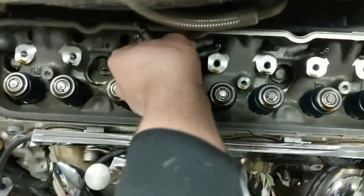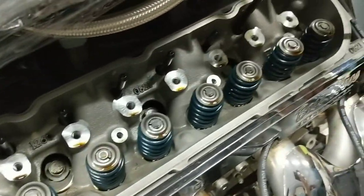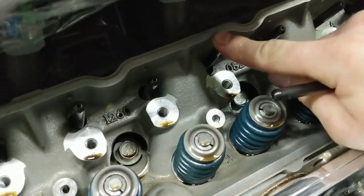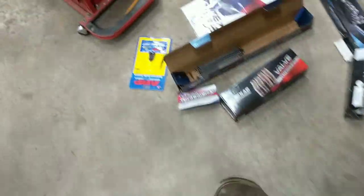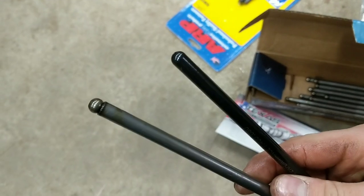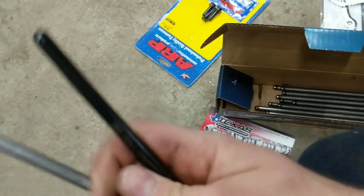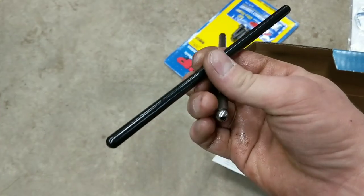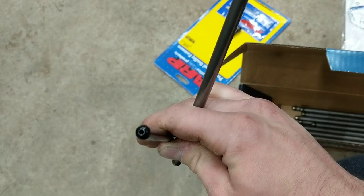I'll go ahead and pull all the push rods out and get ready to install our new ones. These are the 516 standard push rods that they include with most of their kits. I like to go through and push these lifters down the last little bit before putting the rocker arms in because those are held up from your lifter trays. Here's a comparison between a stock push rod and one of the Texas Speed ones: the stock one has the old-school ball design on the end welded on, whereas the Texas Speed one is a single forged design where it's all one piece with no ball to collapse on the end. It still has the hole down the center for your oiling.